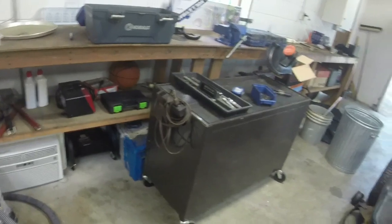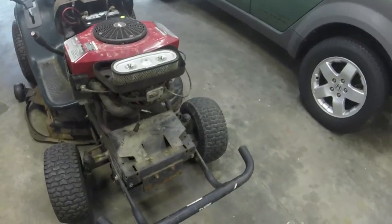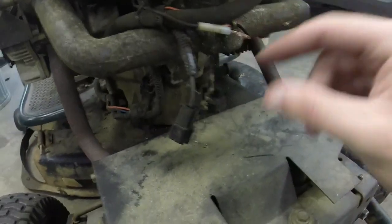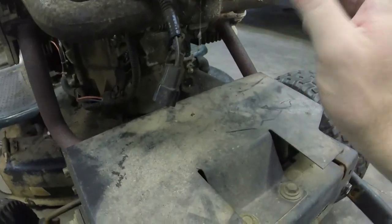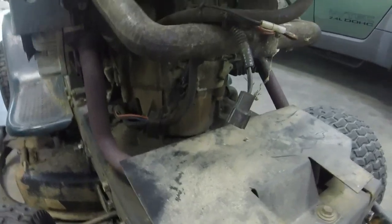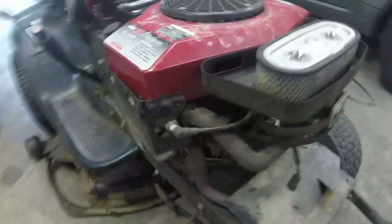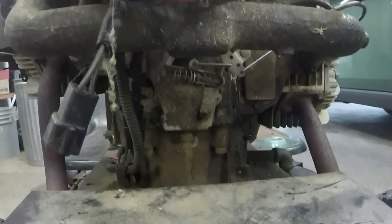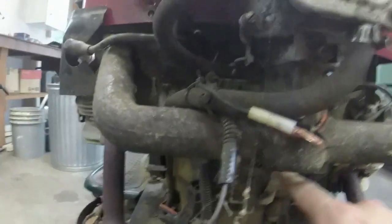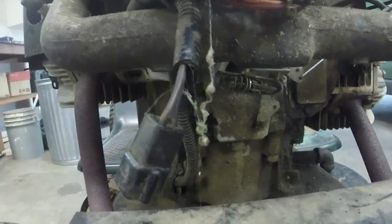I don't think my wiring devices are out here - let me go get some wiring kit. Fix this up to where it's a permanent fixture so it doesn't move around. There's half of the battle right there. Hidden under all that electrical tape is one of these - stuck both sides of the wire in, crimped it with one of these crimpers right here, gave it the tug test, and wrapped it in electrical tape. We have now fixed the ignition switch. Now let's move on to the governor.